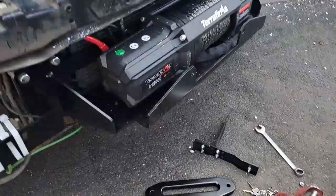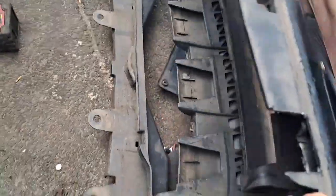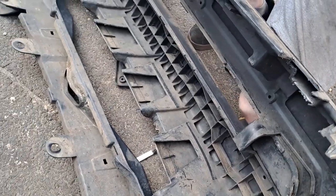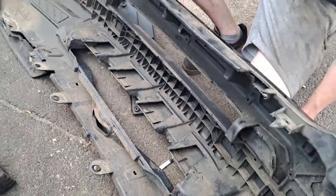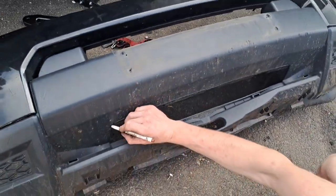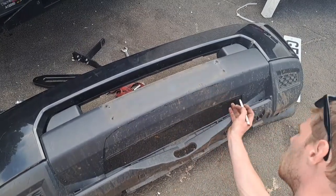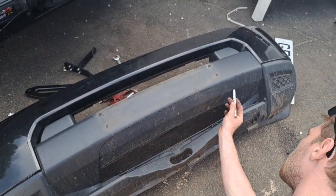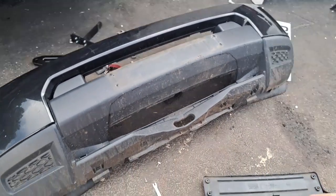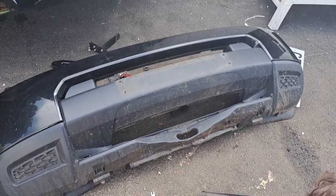The bottom of the winch here is fouling on the internal part of the bumper, so rather than take all of it off at once, we're thinking we're going to try first of all cutting this area out here that Geordie's marking up. That gives us that bit of clearance. We're going to try that first and then if we need more we can take more.